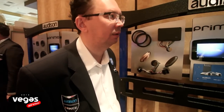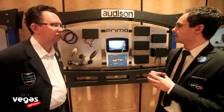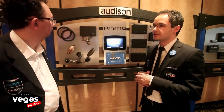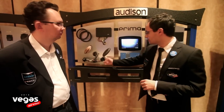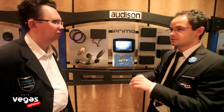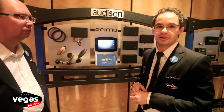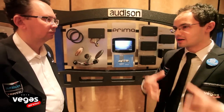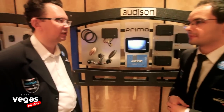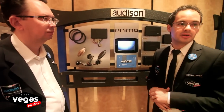You mentioned the beat drive setup — what does it mean? When you get the pack, together with it you also get the beat drive setup. With the beat drive, you get your sound. The beat drive is the setup file for the DSP built into the amplifier. What the dealer has to do is hook up the whole system with the plug-and-play harnesses and install the speakers. Once the installation is complete, the beat drive setup file can be flashed into the amplifier with a simple USB connection to a PC, and then you get the sound. The sound has been conceived and approved by the R&D engineers, who got the car and refined the sound specifically for that model. So we could say it's not just plug-and-play — it's plug-and-sound.